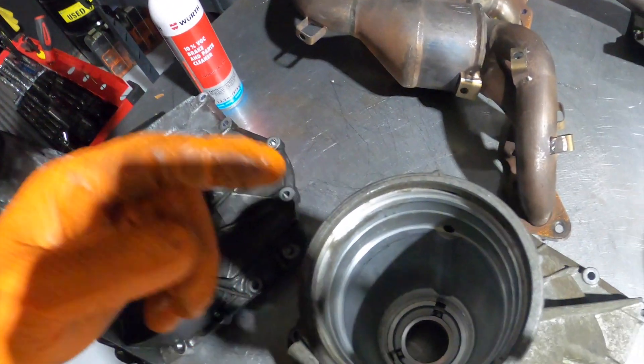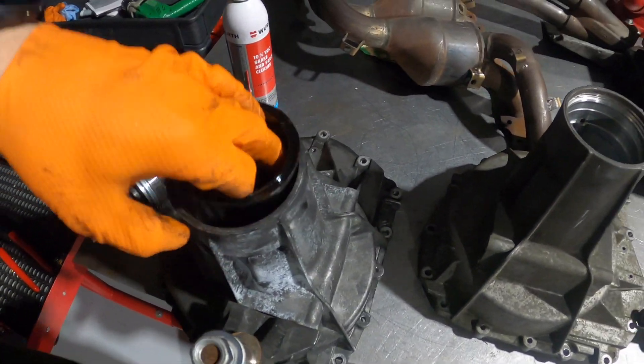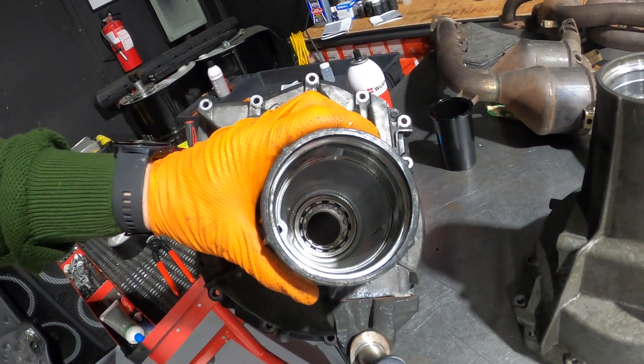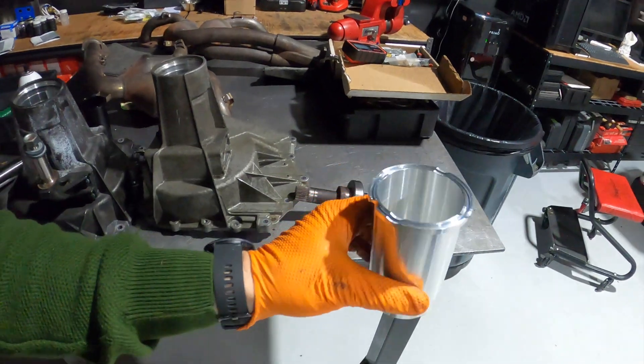Why don't we just pull this out, put Loctite in, and put it back? You can do that, but it's very difficult to get in there and get a puller to pull it out — the bearing is in a blind hole, and it has a metal cage with rollers where the cage is more fragile. So when we take a gearbox apart and it hasn't moved yet, we drive it back down and use our new cone, which is aluminum. We chose aluminum because DCT fluid can damage polymers, and picking the right polymer is extremely important. Aluminum has the same heat expansion properties as the nose cone itself as it heats up.